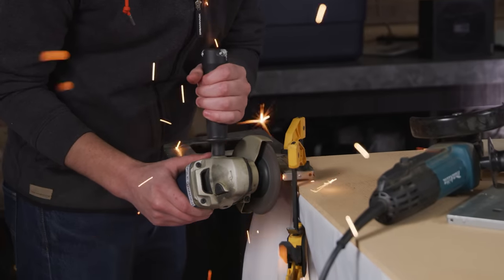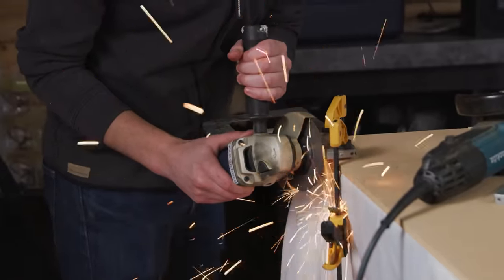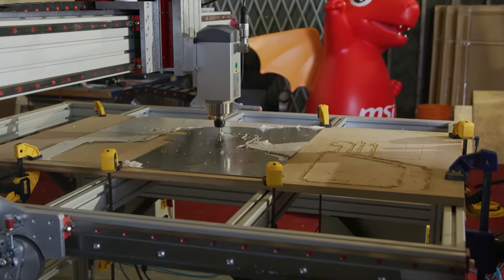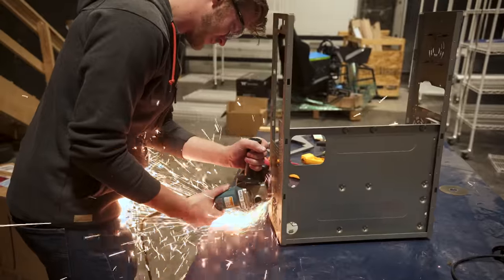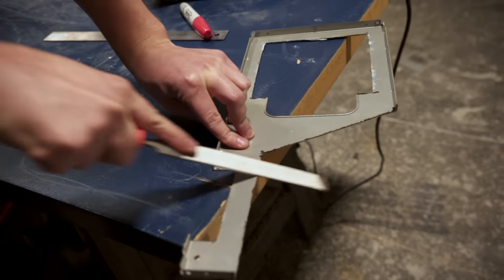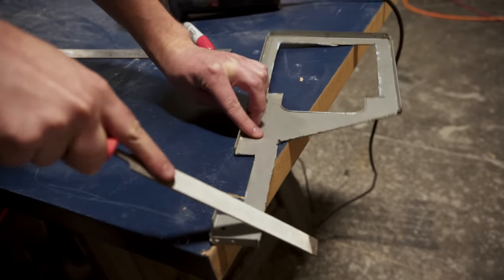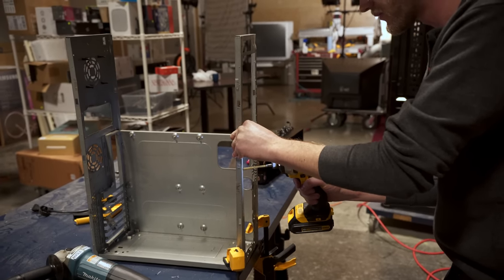We'll need to make room for the radiator, reservoir, and cable management. This will function just fine, but gives up a lot of rigidity compared to the much thicker piece that we were going to CNC. Next, the front of the case got chopped up to give the radiator more airflow, and everything was filed down so that no hands would be cut while working in Margaret. With some radiator mounting holes added, it was time to put the case back together.